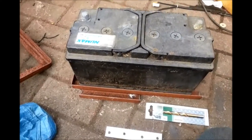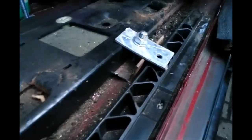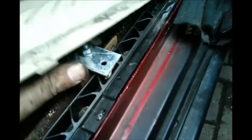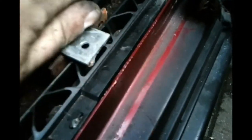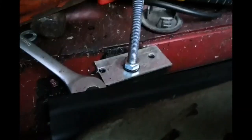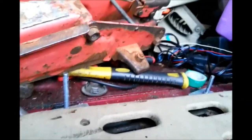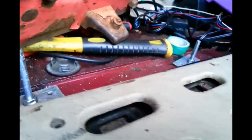Here's the threaded bar through the floor of the van. I had trouble getting the spanner to the nuts because they were so far up against the runner, so I've extended this one and put this arrangement in — it's going nowhere. I'll chop them down once I know the correct length; I might need to tighten them up. The back of the van isn't in active use right now so things can settle and make their own final adjustments, and then I'll trim them.